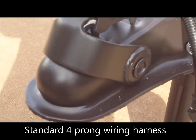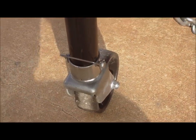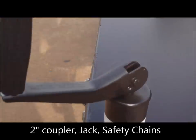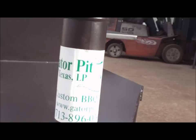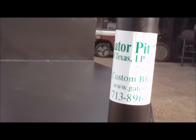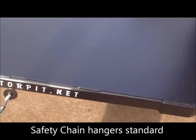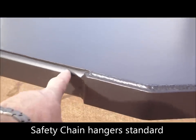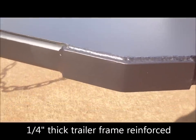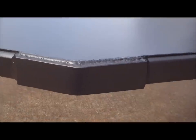We use a two-inch coupler up front — I don't make any trailers less than that. You've got a removable swivel jack wheel and a heavy-duty Bulldog jack — it's a top-line screw jack. Gator Pit quality. We use Dexter axles made right here in America. Our trailers are beefy, reinforced at any of the stress points with quarter-inch straps. This is a stress point on any trailer that V's in at the tongue — we make sure you don't have any problems with it stressing down the highway.